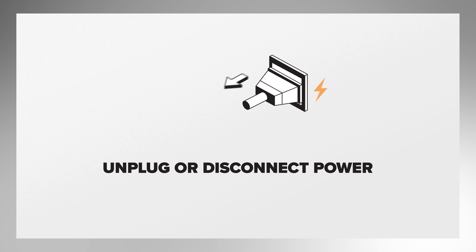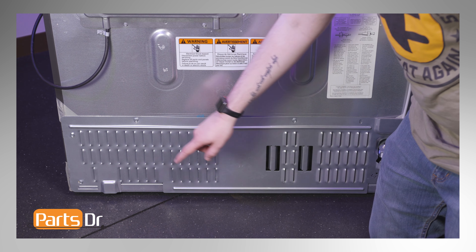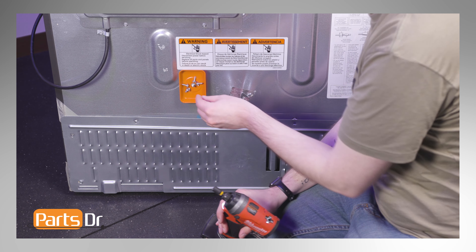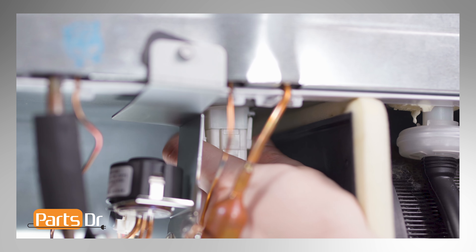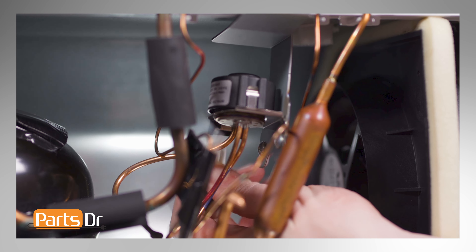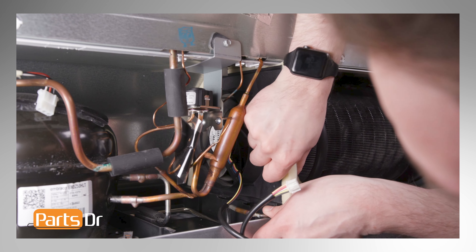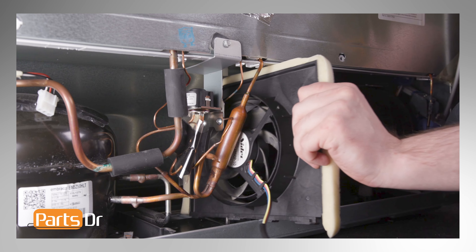Next, we will be removing the condenser fan motor. Since we will be working on the refrigerator's electrical components, disconnect the power to the refrigerator. With access to the back of the refrigerator, remove the screws holding the compressor access cover in place using a 5/16 inch nut driver, then slide the cover up to remove. The condenser fan motor assembly is located here. Disconnect the two electrical connectors by depressing the locking tabs. Then peel the foam up and gently pull the refrigerant tube forward and down. With the refrigerant tube out of the way, pull the motor housing towards you to free it from the locking tabs, then lift the assembly up and swing the bottom out. This will require a great deal of effort. Push the top away from the condenser coil and pull the fan assembly out of the machine compartment.